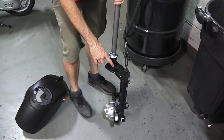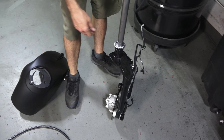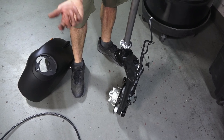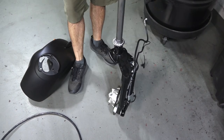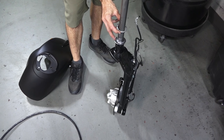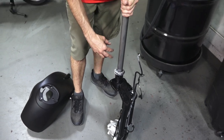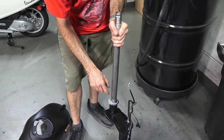This is the much newer fork — now a cast steel upper, much more rigid. The newer GTSs seem to ride better because they've rigidized this fork quite a bit, though it's still the traditional Vespa fork design. If you're doing this on a scooter with 25,000 miles or more, or bearings that feel bad and have a notch when steering, it's advisable to replace the bearings. You have the bearing itself, the cage bearing, the race, and a tin cup you typically replace. We sell these bearing kits as complete lower and complete upper sets — part numbers will be in the description. We'll certainly put more grease on these bearings.